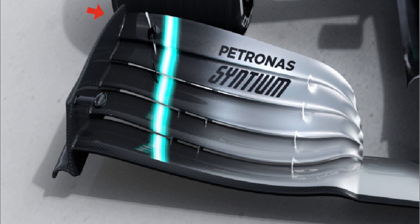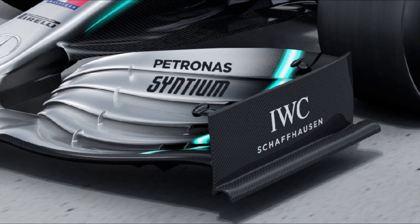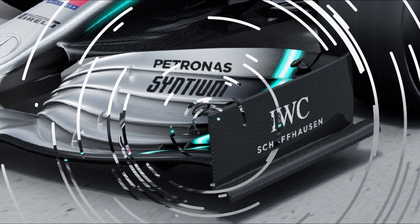This leads us to perhaps the most surprising and intriguing aspect of their front wing design — the shape of the endplate, which rather than being skewed outward and releasing that airflow outboard, actually tapers back inward slightly. This likely forces the outwashing vortices being created by the other elements to form a larger flow field and push flow across and around the front tyre.